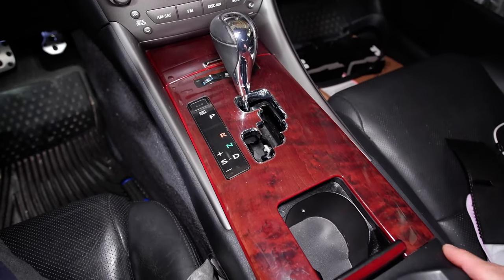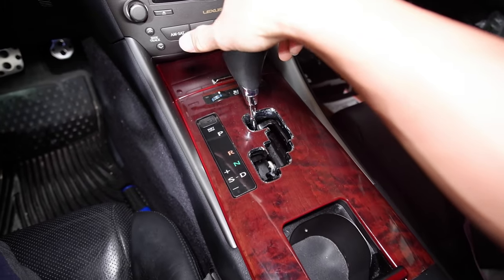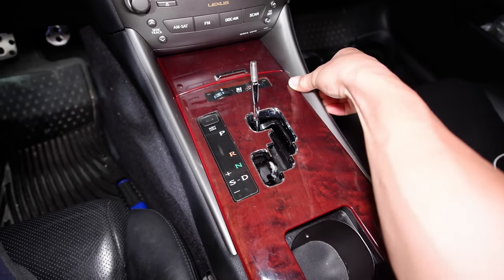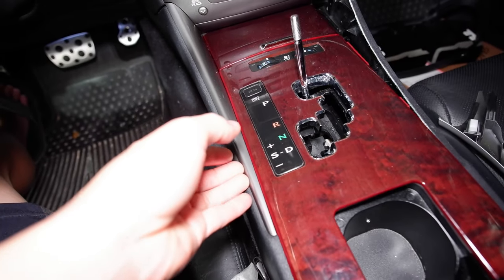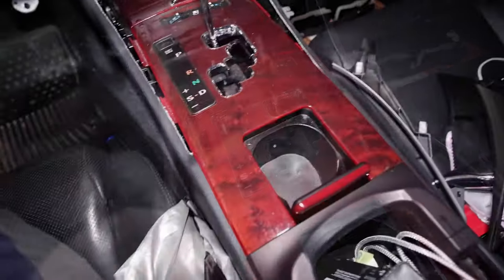So to change this is pretty straightforward and easy. First thing you need to do is just take apart your shift knob — that thing just screws right off. Then pop the two little gray pieces right here on the side, which is pretty easy. It doesn't even require any tools. If you have fingernails, you can just pull it right off on either side. If you don't have fingernails, a credit card or anything you can get under there will work just fine. It comes right out.